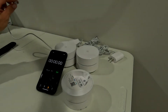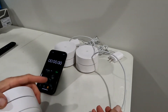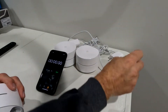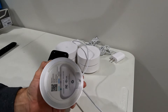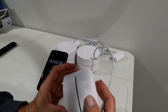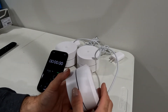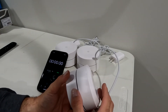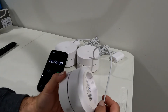I'm going to turn off the light so you can actually see the lights on the mesh system. I've got a stopwatch set up on my phone so you can see how long this actually takes. It's going to go through a series of flashing lights. When you press and hold the back button and plug it in, you're looking for a blue flashing light. Hold it until you see blue flashing. If you get an orange flashing light, you've gone too far — pull the plug and start over.